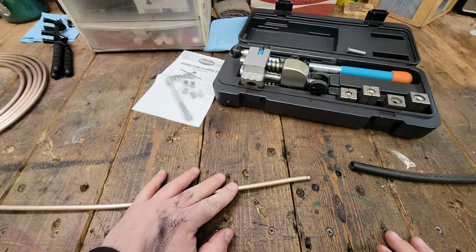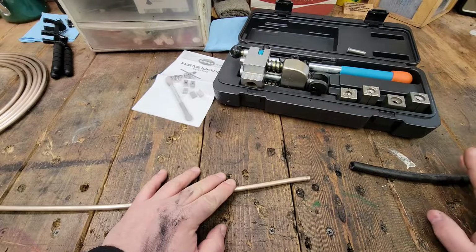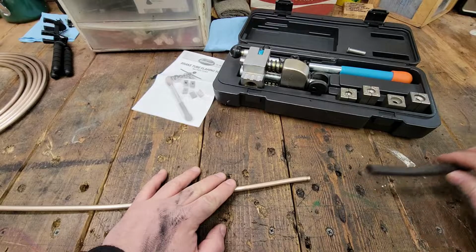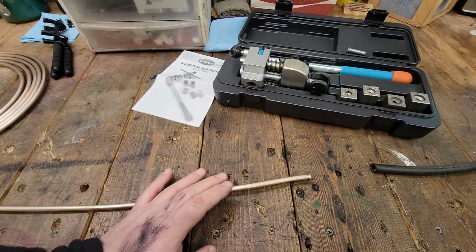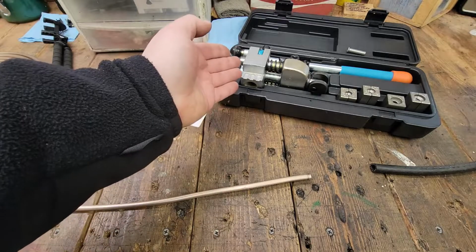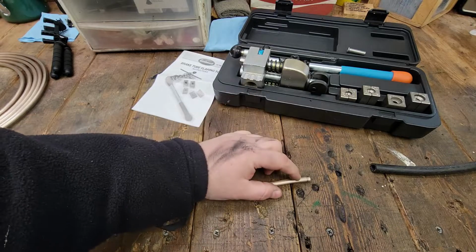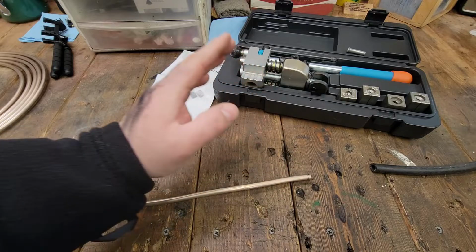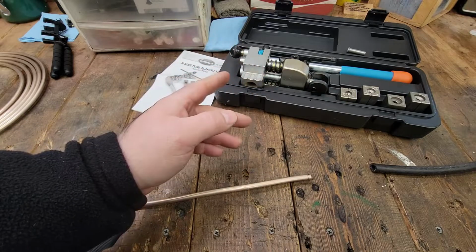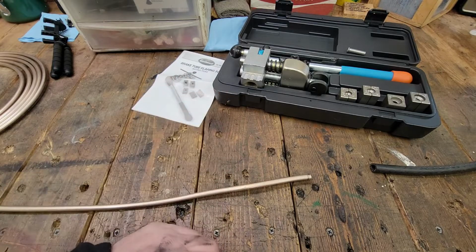These things run at 60 psi according to Nissan specifications. So I'm a little concerned that this might end up off of it, right? So I figure, I got this fancy dancy little flaring tool here. Now granted, this was not going to give me the little ridge that the lines you buy will have. I'm going to try something with one of the settings this has on it, and we'll learn together.